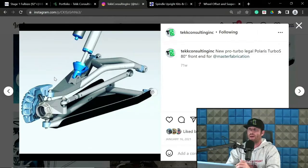So to recap and review, for rear-wheel drive trucks, I like to be in the inch and a quarter, inch and a half range personally, although I have seen stuff that is sub 1 inch that is successful, and stuff that's 2 inch and change that is successful as well. For buggies, I have no problem going a little bit more, closer to the 2 inch range, or for rear engine trucks. For sand cars and sand trucks, you could totally be sub 1 inch.